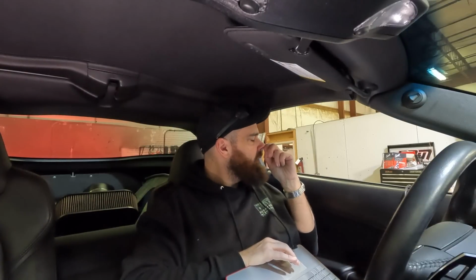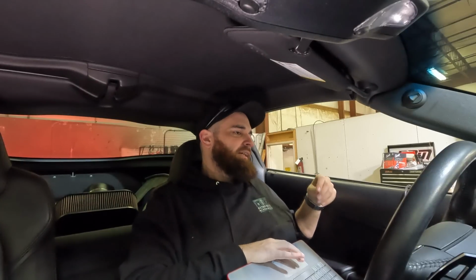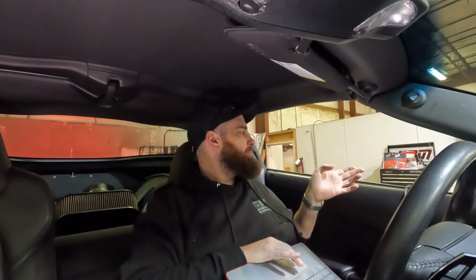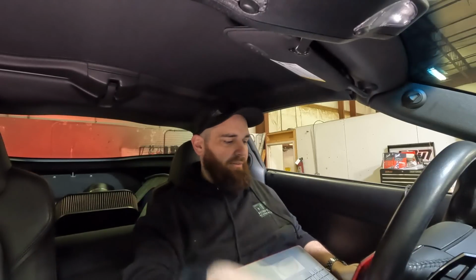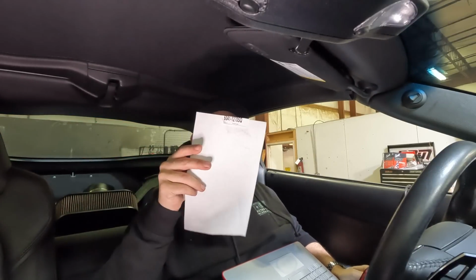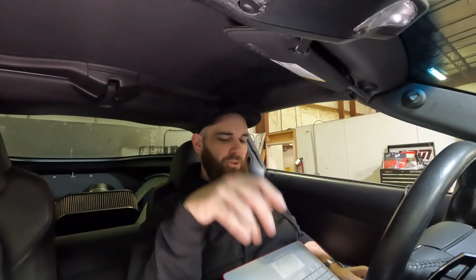My guess. So we'll see. It may make a little more than that. Just depends how much boost, but generally 150 is a fair bet. No, it'll make more than that. Yeah, it'll probably make like 580. Depends how much boost. If it makes like 9 or 10 pounds, it'll probably make 600. It'll probably pick up close to 200. And it's got a 3.8 pulley, so I don't know if it'll make that much boost, but we'll find out. It's a V3T trim blower.